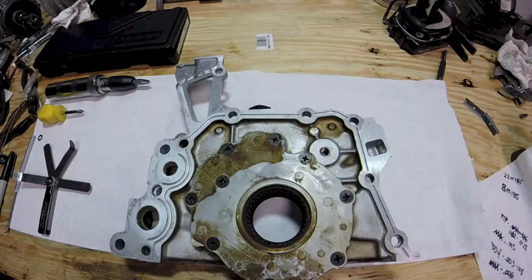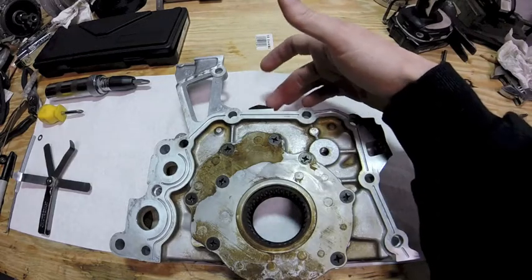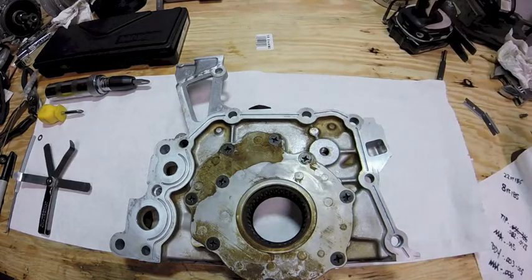The engine was very clean — oil was clean, there was no sludge buildup. Pulled the cam covers and the oil pump. Everything looked good, but when I went to check the timing belt and things on the front end I noticed that the pressure regulator for the oil pump was leaking, and all that is is an o-ring. I figured if I was going to take the thing apart I might as well check everything while it's apart.